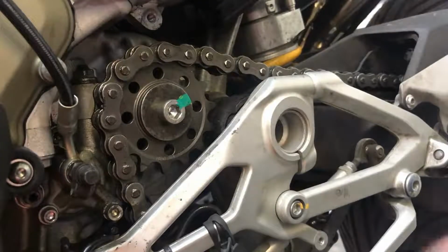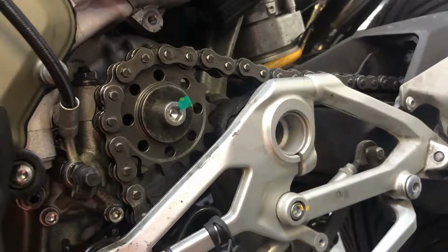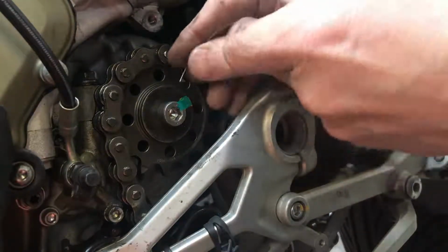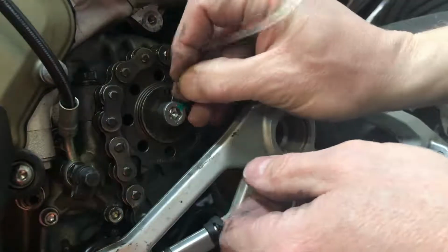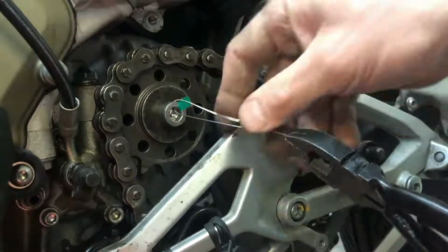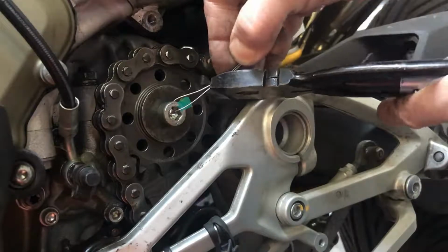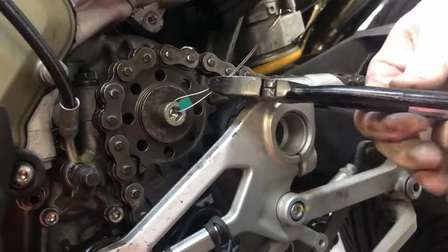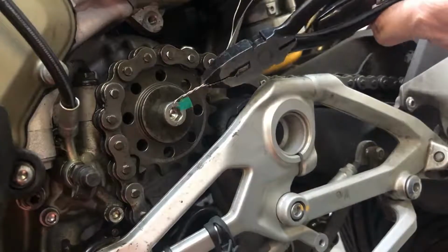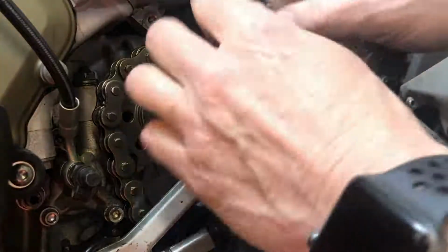Okay, step 2. What we do is we take off some safety wire, and you don't need a lot of it, but always try and get as much as you can with one pinch, because you don't want to safety wire the safety wire. And what you do is you cut it off and feed it through the hole. Remember we did this hole last weekend? So feed it through, nice and tight, even it up, kind of go to the far side of the hole, lock your safety wires up, and simply pull the little ribbon, pull the back. Spins around, nice and tight. Bing, bang, boom.